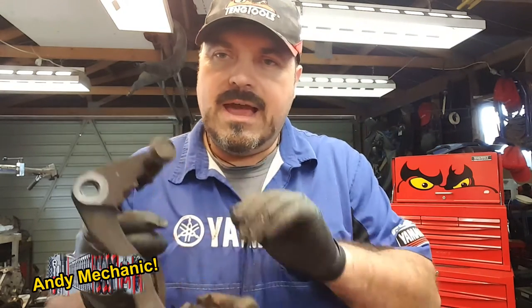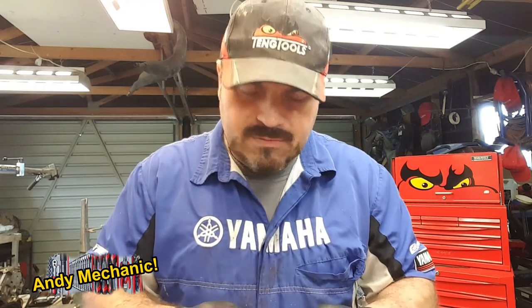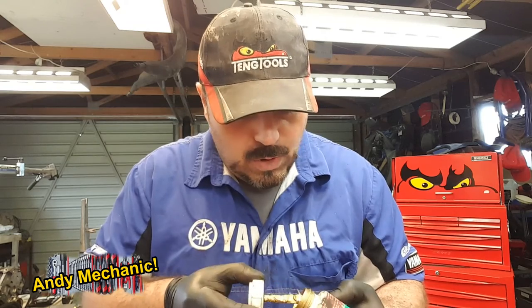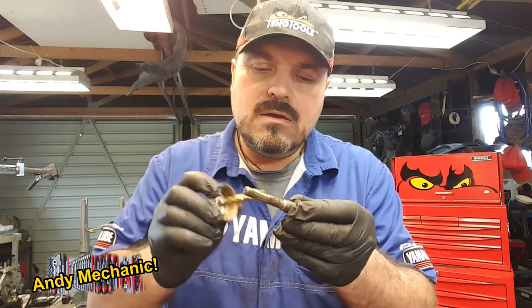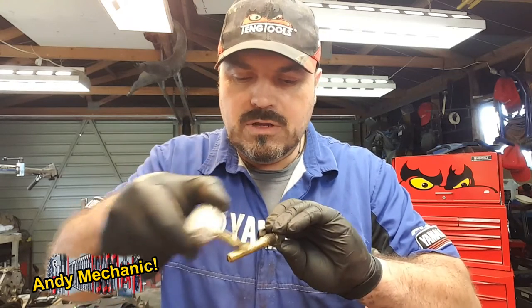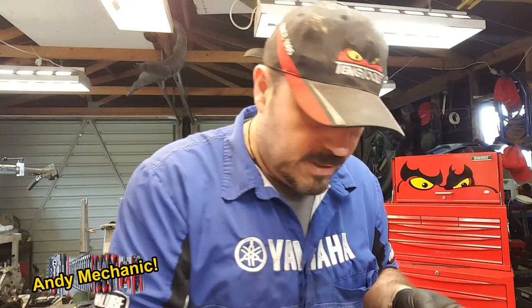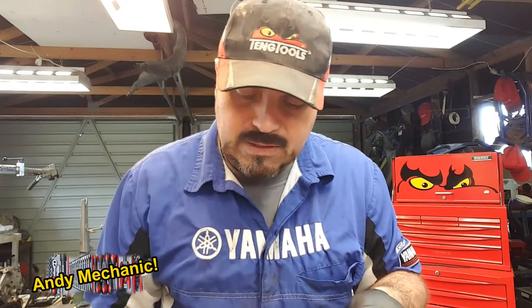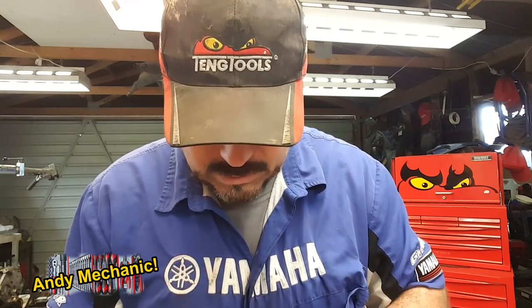One of those is we can add some more copper paste onto the slider bolts. And you should have some of this. It lasts for quite a while, you don't need very much. And all you need to do, and you'll see usually on these there's a little flat groove, and that acts as a reservoir for the copper paste, and you don't need lots. And I mean, officially where the threads are, we should have thread lock on the threads, but I'll put that on when we get back outside and we start to assemble it. So there we go, look, that's better. Now obviously when you're putting thread lock on the threads, they've got to be clean of any kind of grease and oil. There's no point in putting thread lock on something that's got copper paste on.